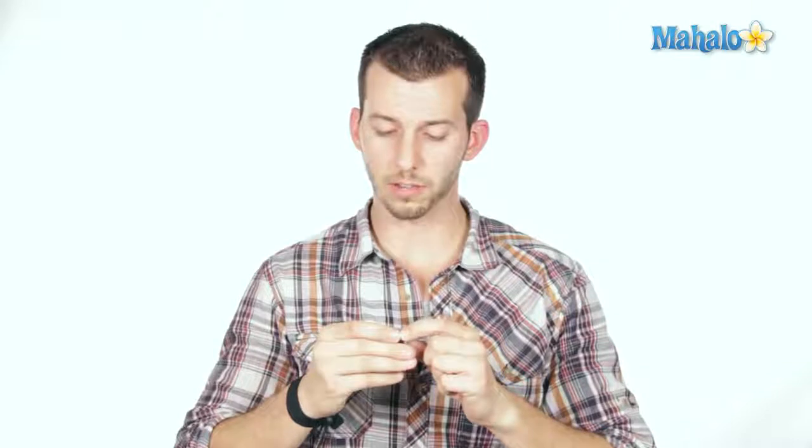So, to upgrade your processor, you'll want a couple things ahead of time. One of the things you'd like to have for upgrading or changing out processors, definitely do not do this without this component, is thermal paste, whether it be Arctic Silver 5, which is high density polysynthetic silver thermal compound, or just heatsink compound. So you want to have a thermal compound. Now you might be saying to yourself, what do I need thermal compound for? Well, you absolutely have to have thermal compound because you can think of it as the oil in your engine, because you can't drive your car without oil. The thermal compound will be used to transfer heat between your processor and your heatsink. So it's an essential item.